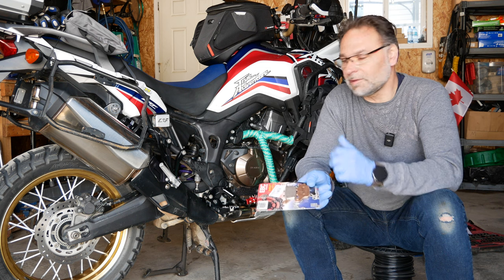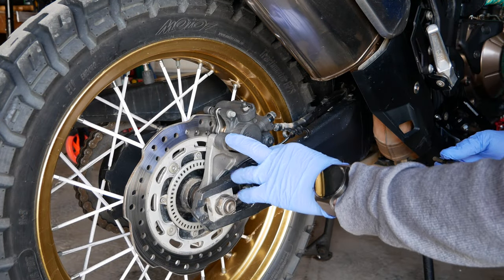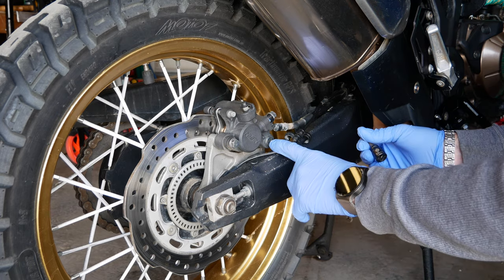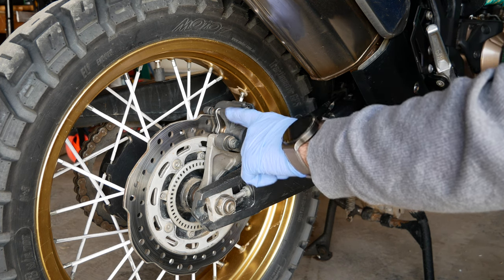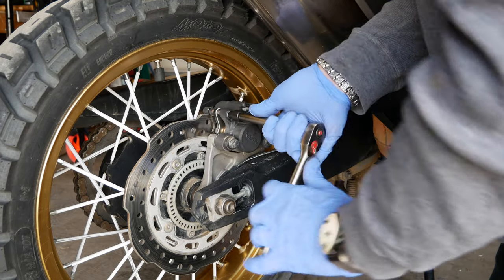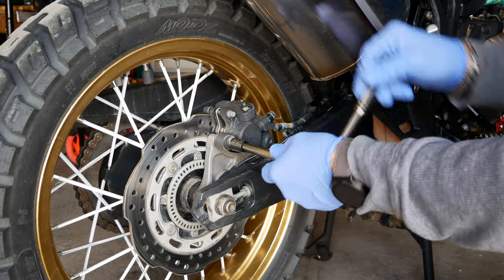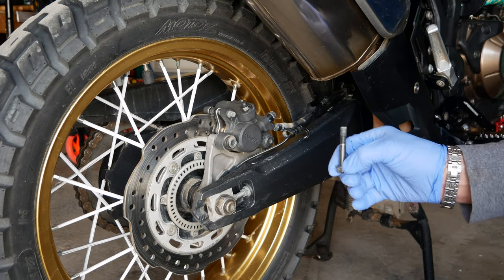It's pretty simple — you don't even have to take the rear wheel off. I'll show you how it's done. To start the process, we want to undo those two bolts. There is one with a 12 millimeter socket and one with a 6 millimeter allen key to loosen those. The first thing you want to do is loosen that pin right here while it's still installed. You want to place the bolts on a clean surface.